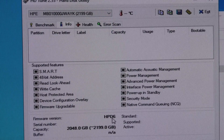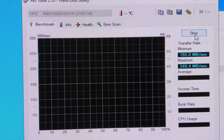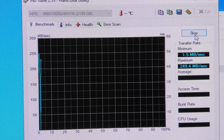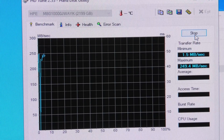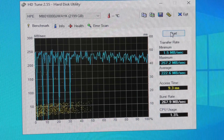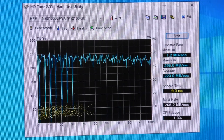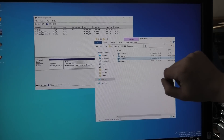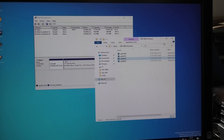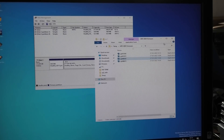Testing the newly updated drive — it has HPD6 now. Running the benchmark on one of the bad drives: it's still dodgy, running it once more to see if it just needed to warm up. Even with new firmware it's not great. Looking at the firmware files, it turns out HPD2 was available in A, B, C, D versions. I got the latest one and tried putting it on — it installed fine but made absolutely no difference whatsoever.